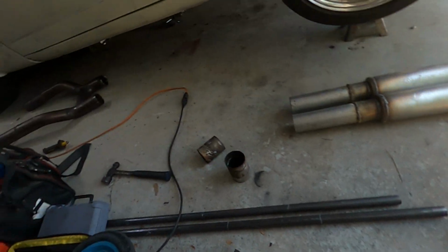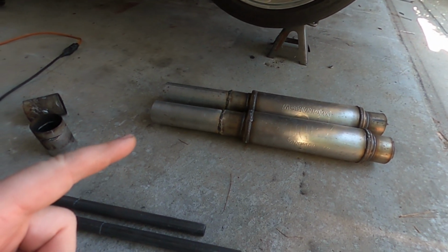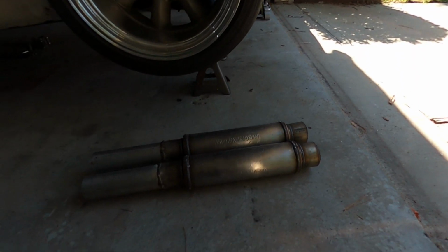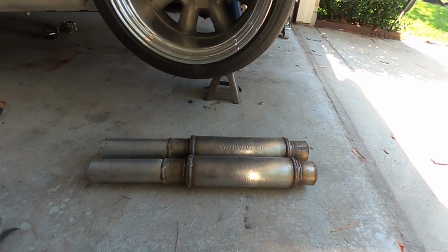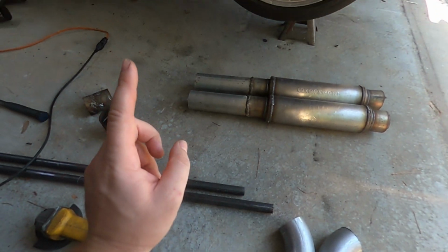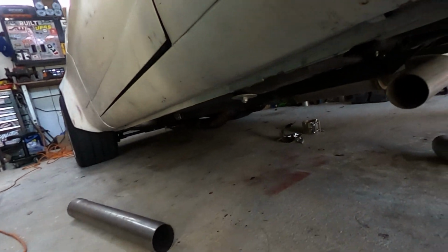Trying to think. Yeah, so let's probably go ahead, best to bolt up that H pipe. I can use the clamps to kind of put these guys in place. Maybe grab the jack over there to kind of hold them up and help support the weight, and then start planning out where these 90s and where it's going to exit in this vicinity.